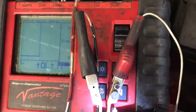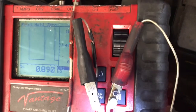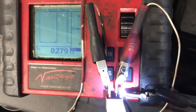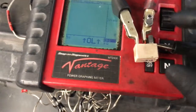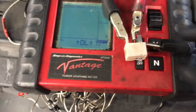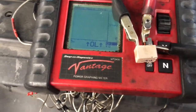Relay closes, relay opens — that's what a good relay looks like. If this was a bad relay, when you apply power and ground with the power probe, the ohm meter would read infinity like it is right now when the circuit is open. That's how you test a relay that doesn't have the wiring diagram printed on it and also doesn't have the pin numbers.